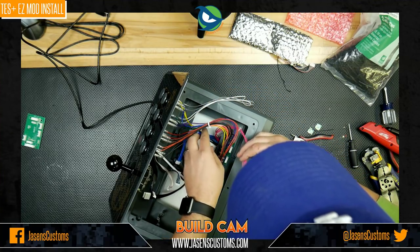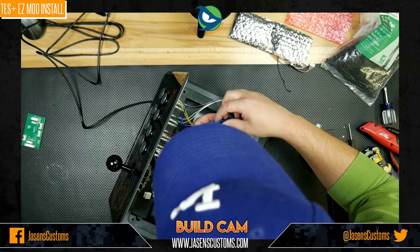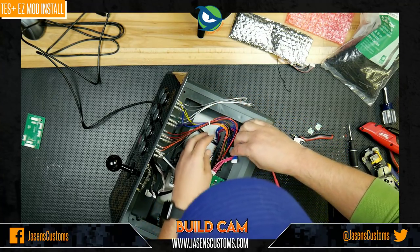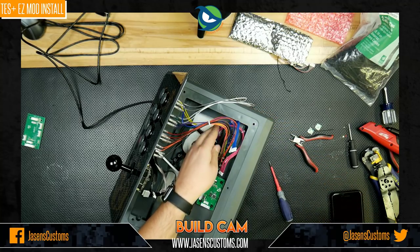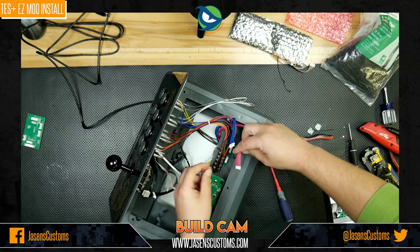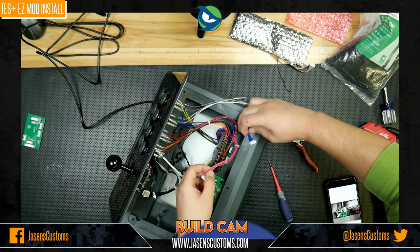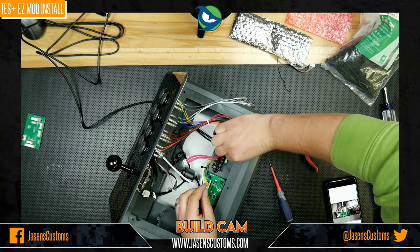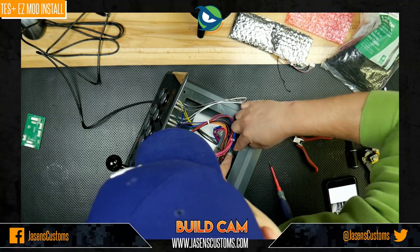This red wire and this blue wire have to come up, and you have to make sure that it clears all the bottom connectors on these buttons. Now, these are different lengths, so you can't accidentally put them in the wrong spot. Let me just double check something here. Yep. The red one, the longer of the two, goes all the way over, and the blue one, the shorter of the two, connects to your very first connector here. So let's go ahead and just clip those in. You'll feel them clip into place.